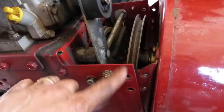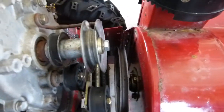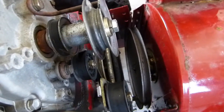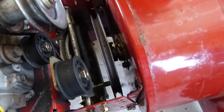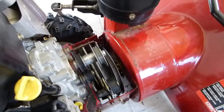To quickly show what this looks like when it's broken apart: the top four bolts — two on each side — are removed and the bottom bolts are loosened so the whole machine can pivot. What that does is open up space between the pulley and the rest of the drive mechanism, and then you're able to slip the belt in between the tensioner and the pulley and just rock the machine back together and it'll line back up. I'll put the camera down and thread the belt in there.